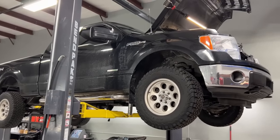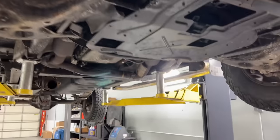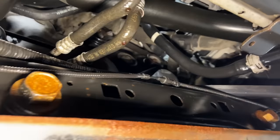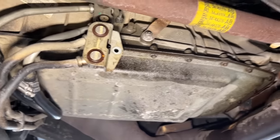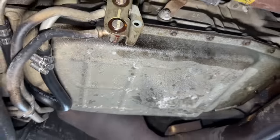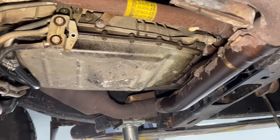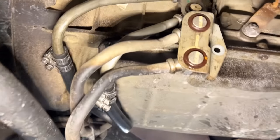These transmissions have some software issues but they are great transmissions. This is like the one fatal flaw — the Achilles heel of the 6R80. Here's the transmission; that's how you can identify the six speed — it usually says '6R' right there on the side. It's a great transmission. It's all solenoid-based; you maintain the fluid in there and this thing will reward you 200 to 300,000 miles. But these lines go — look at the size of these lines on here.